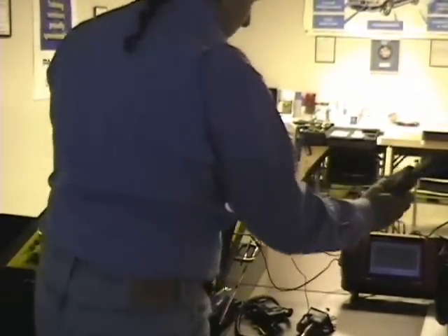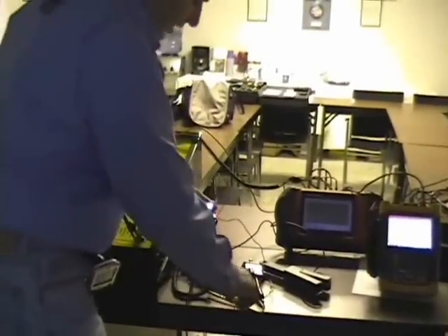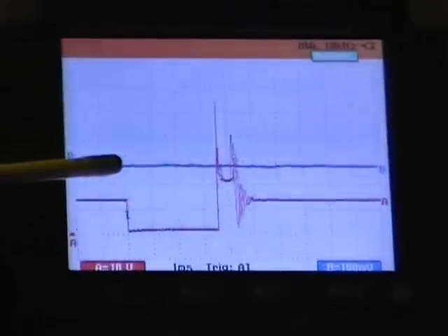What I'm going to do is take this amp clamp and I can either go around this wire or the other wire. I have power going in, jumper wires — the little GM or Thexton leads in there. And when I click the motor, look at the amperage right here. You see how that amperage is going up? Don't worry about the red, look at the blue.